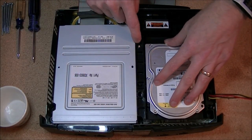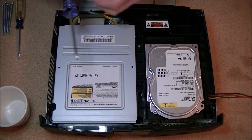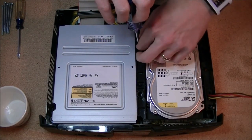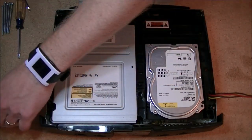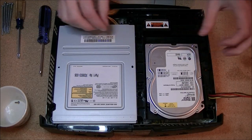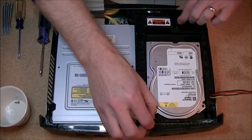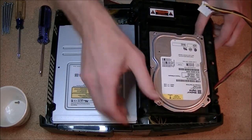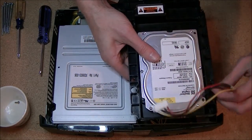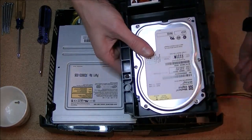Remove the cable from the side tray as best you can. There are three screws to get all of these components out — one for the hard drive and two for the optical drive — so that's where your T10 comes in handy. I also like to have a little bowl nearby so I don't lose my screws. Once the hard drive screw is out, you can take the entire black tray out. The power cable will want to hold on, so once you get it out a little bit, you'll have some room to remove that cable.